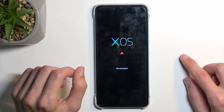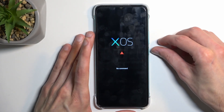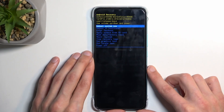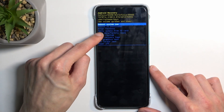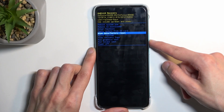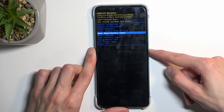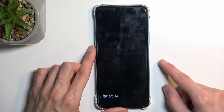When you see this page, let go of your volume up as well. To get past this, hold the power key and press volume up — this will take us to recovery mode. Here, using the volume keys, select wipe data factory reset, then confirm it with the power key, select factory data reset again using volume keys, and confirm with power.